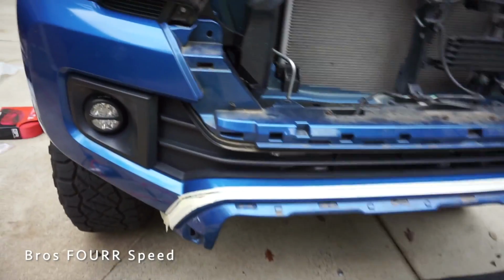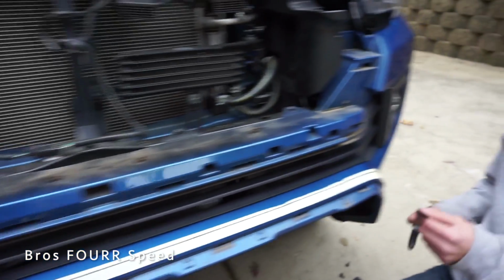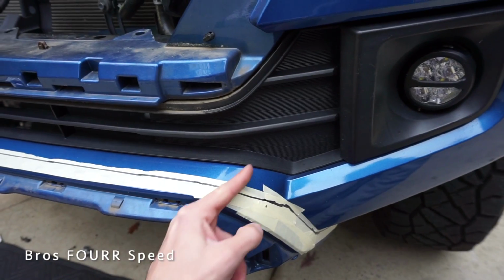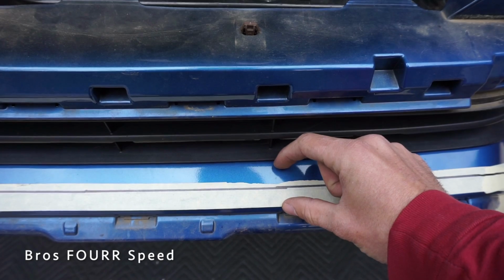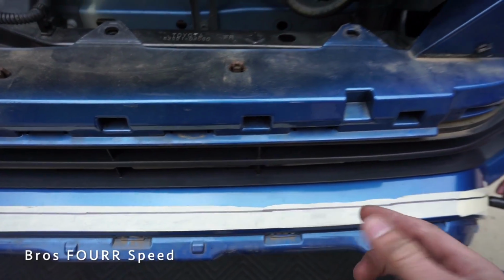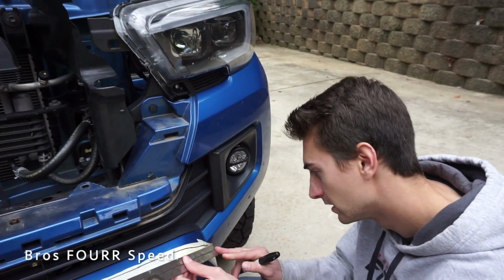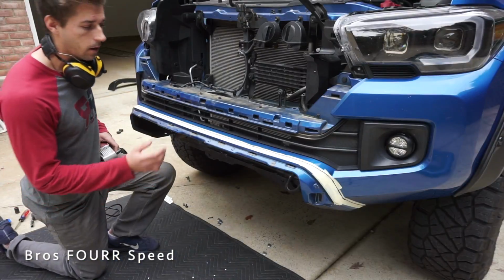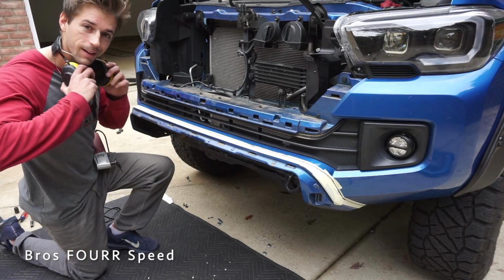So what we did on this side is we changed our line just a little bit. It's the top line that you see, more of a direct line instead of having a weird angle to it. The 20 millimeters is basically the point, and then on the inside, which is roughly center of this piece. We're looking for the center between my fingers here, and we're actually farther towards me than actual center. So technically we have a couple millimeters of forgiveness in our cut. If we have to trim a little bit more, I'd rather do that, but that looks a lot better. Yeah, just about right there. So we have all our measurements hopefully correct. We have a little bit of leeway if we have to do some trimming. So let's get to it.